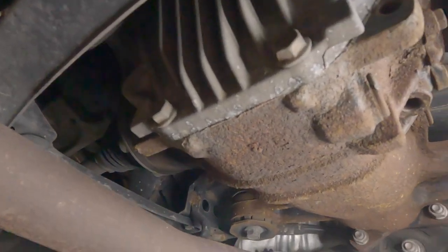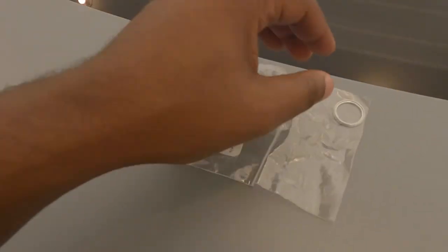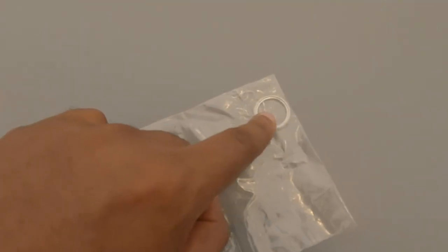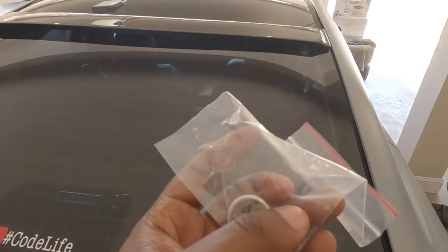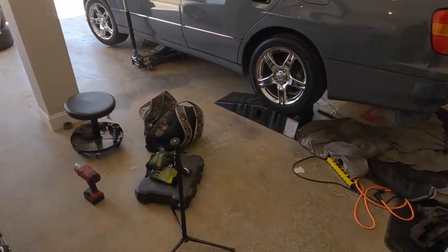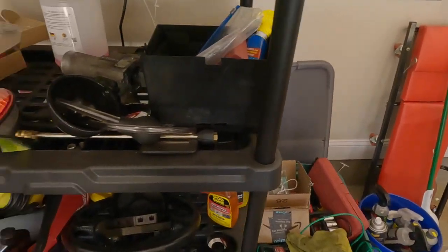The diff does look a little rusty - it has seen better days. If any part of the car is going to rust it's probably going to be this, but it's kind of expected. I realized I need two crush washers - one for the drain and one for the fill. I couldn't remember if the fill plug had a washer on it, but turns out it does. Last thing I want to do is create leaks, so I'm going to go pick that up.